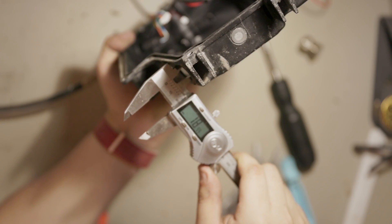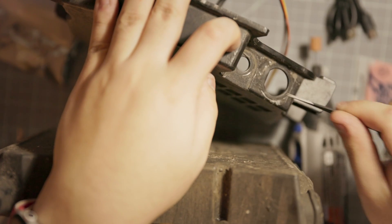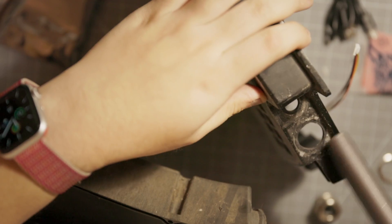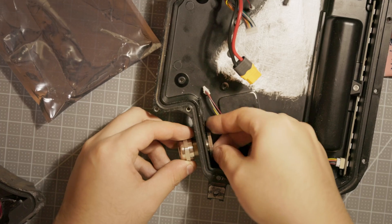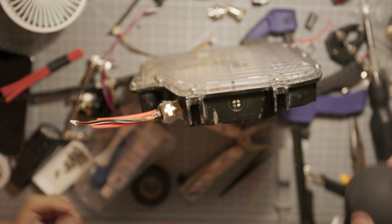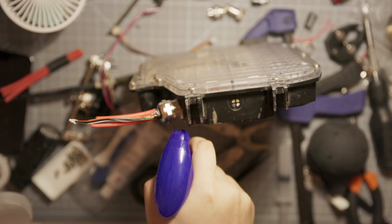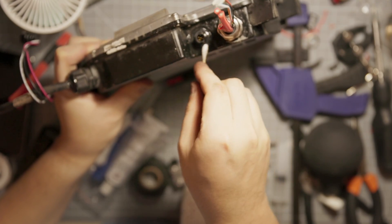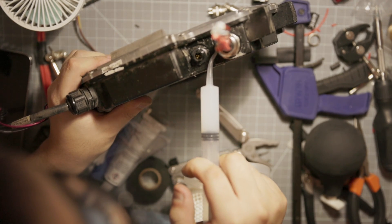With the controller and battery module working, we now need to fit the cable gland in so we can pass all the motor wires through. The hole is big enough, but this notch is preventing the cable gland from sitting in — it's super easy, barely an inconvenience to trim it out. I made a dummy cable that consists of the same wires as the motor wire, just to test waterproofing. This is just the right thickness for the 19mm cable gland.